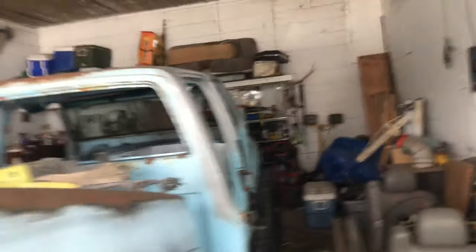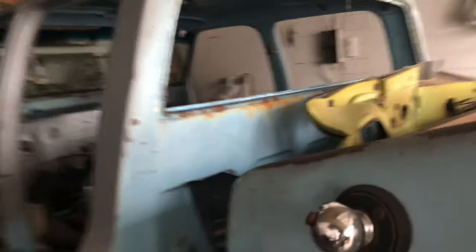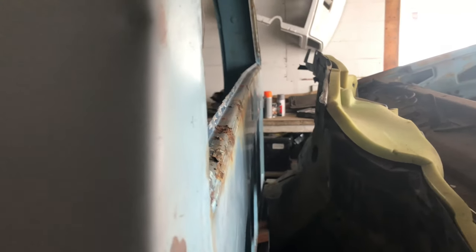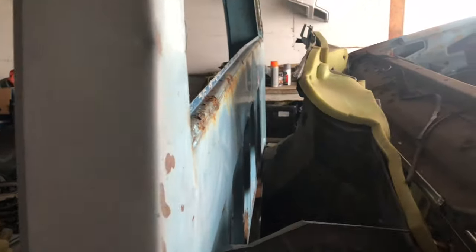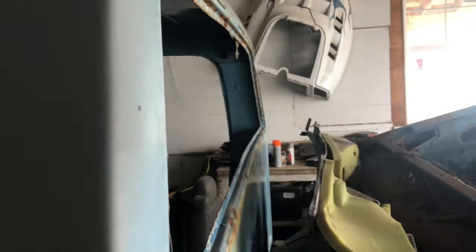I just got the other side sprayed up. You can see I got the rear window removed — I didn't think I'd be able to do that by myself but it was actually not too hard. I just cut the seal on one side and pushed a screwdriver through and ripped it apart. There are a couple things I'm going to have to fix: there's a crease in there, the window frame is actually bent right where the two panes come together on the slider. There's also some hardcore surface rust and a dent up top that I'll need to fix.